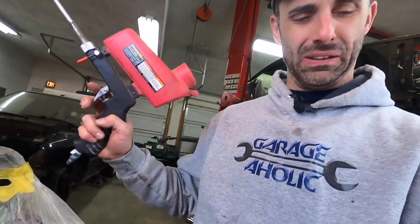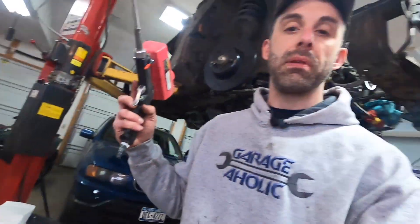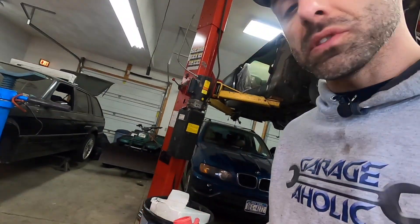When you're sandblasting, you want to make sure you're using the right type of sandblaster. There are many different types, but for the most economical choice, it's either this handheld blaster — basically like a gravity gun — or you can go with something like this 40-pound sandblaster. I'm going to be using fine walnut shells. I do not recommend the handheld one; you have to fill it up quite often, and you'll have trouble getting it through the siphon. You'll get much better and quicker results blasting intake valves if you use an actual sandblaster machine.